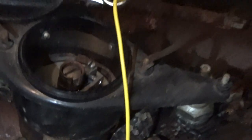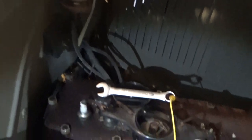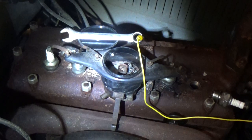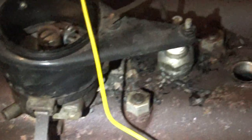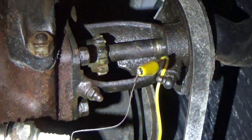To make sure it's still not fouled out, I put a ground wire onto the top of the plug and ran the ground wire over to the coil, where the wire comes out of the coil into the cap. Then I rested the wrench on the cap and attached the wire to one end of it, and the other end of the wire to the plug.